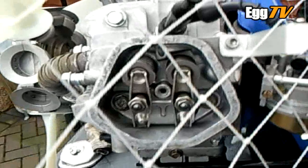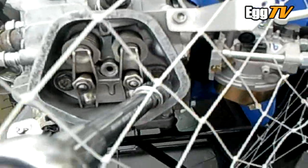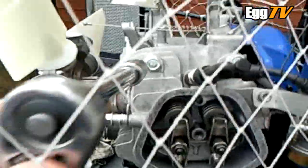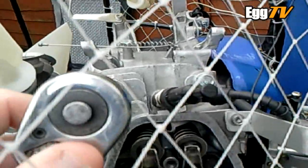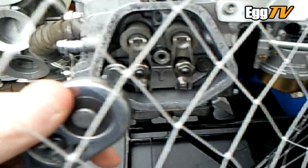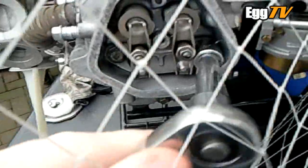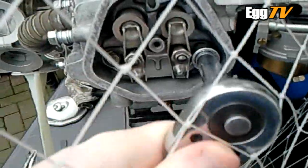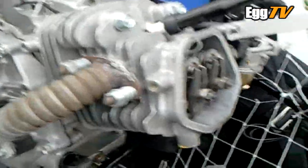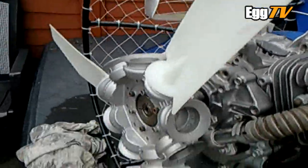I'm going to hold off and take the head off for the time being, because I've got a few degrees of extra turnage on the head bolts just by hand — and I know I torqued these up properly as per the specs. Especially on this one bolt I've got a little bit more movement. If that's where the oil's coming out, there might not be a good enough seal there. So I'll explore one or two other avenues first before I decide to take the head off.